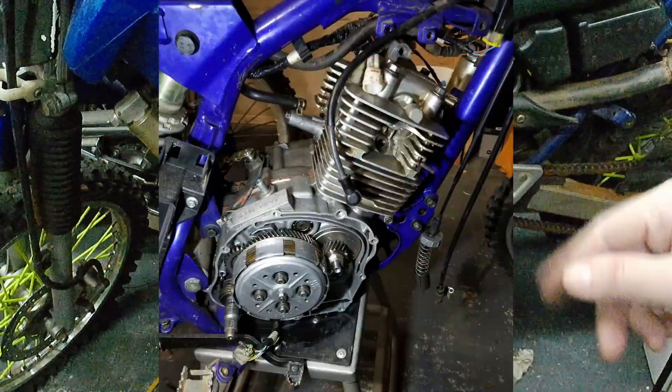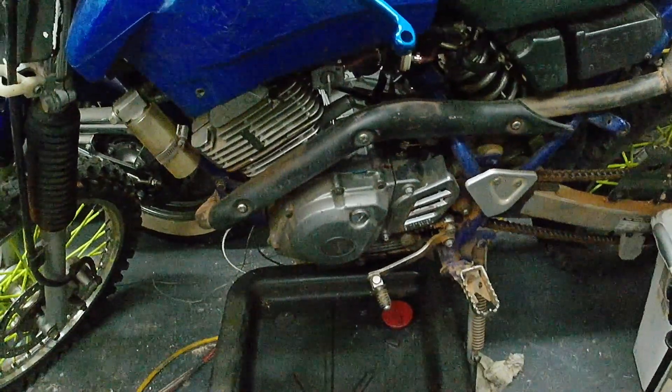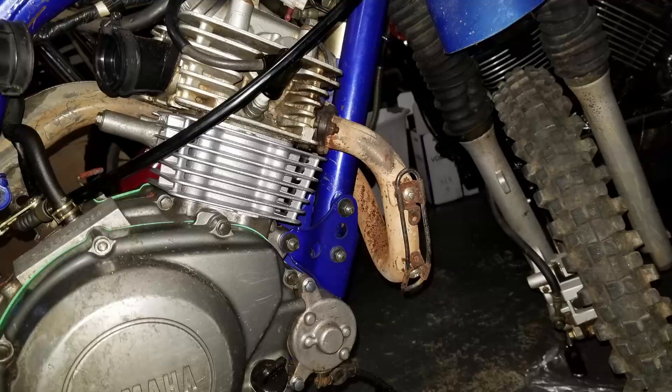This season I've had to clean the carburetor out. The needle valve, one of them was clogged. Once I cleaned the carburetor out and adjusted it a little, I'm getting it ready to run. I'm going to change the oil now because that was the first break-in oil. You don't want to run more than about a few hours on that before changing it. These engines don't have oil filters, so you really need to go ahead and change that oil after the first ride.